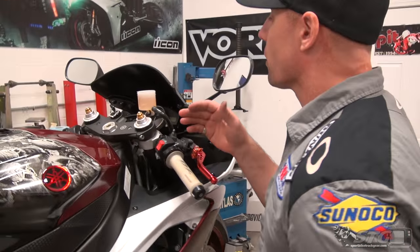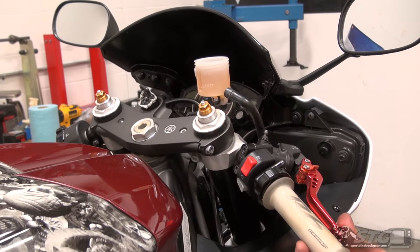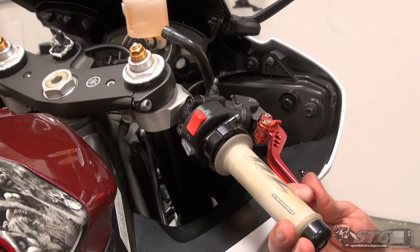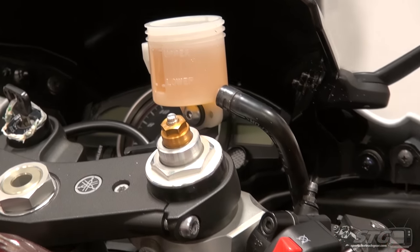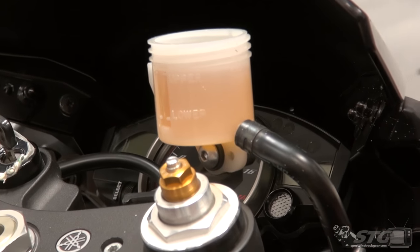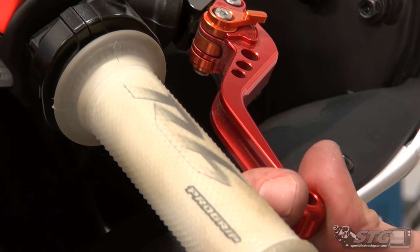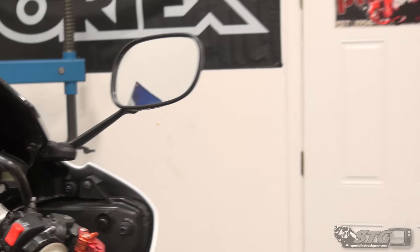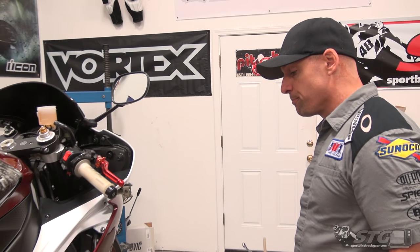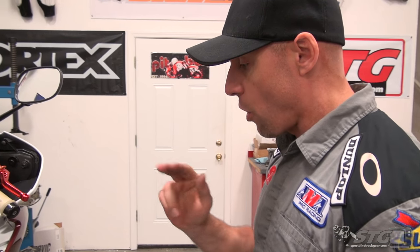We poured the fluid in and I've let it gravity down just a little bit. A couple of different things you can do — you could actually put a cable tie holding the brake lever open partially, and that really encourages the fluid to flow down into the calipers. That's what it's all about right now: just getting the fluid to start moving. Once we get the fluid to start moving — remember, this whole system is dry — the process is going to happen really, really quickly. But it's all about that initial flow of fluid.